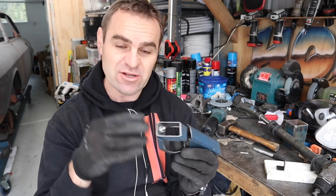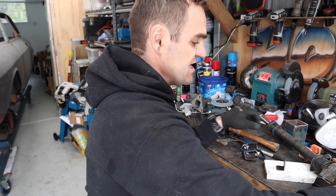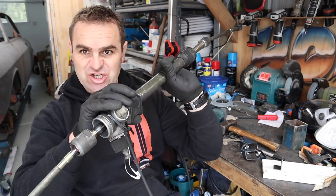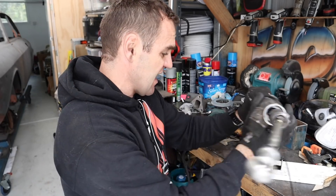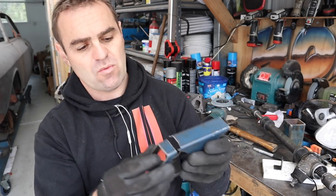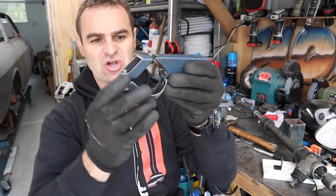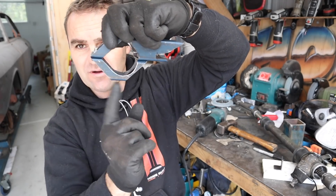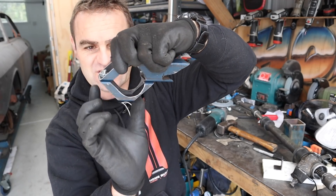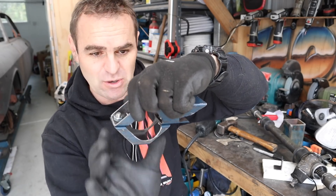After lots of playing around, I got on the drill press and did some drilling. It's starting to look like the piece it's supposed to. You can see it makes roughly a D shape, and that matches the D shape on this steering rack to mount it into the car. I've cut different pieces of box section so that this top part will be one piece, the bottom part will bolt on either side, and that's the bracket that holds the rack onto the car — you can remove it by just clipping it up and down.